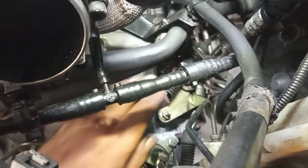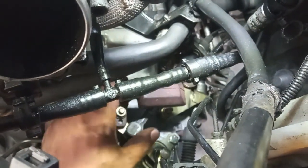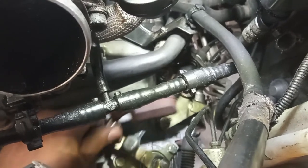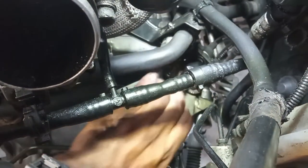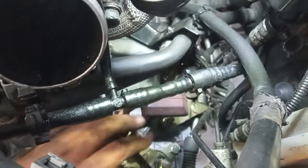And now as you can see, this counterweight over here. By the way, do not remove this counterweight. It helps you a lot changing gears. It is really here for that. It is here for creating a balance while you are changing gears, okay? As you can see, I have more than a finger now of clearance to change gears. Very nice.